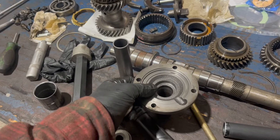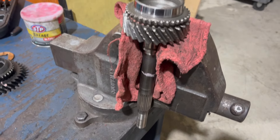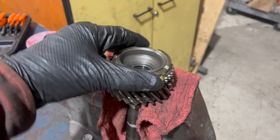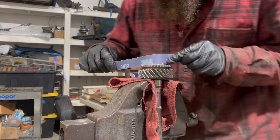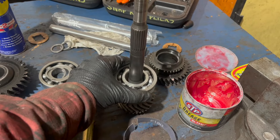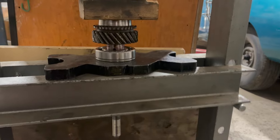Got the IBR cleaned - I'm going to drive in the new seal, which annoyingly goes this way. I'll probably use this thingy and a hammer. Prepping the input shaft now - it's been through one round of cleaning. Now I'm going to take some 180-grit emery cloth and rough this surface up a bit, just removing the glaze from it so the synchronizer lock ring has a nice surface to dig into. Definitely don't need to go super ham on this, just a little bit of clean. Time to press the input bearing into place. Make sure the groove is pointing up. I did grease that thing as well, which is probably why it's going right in.